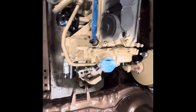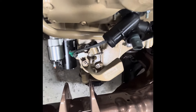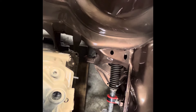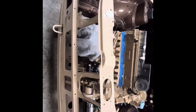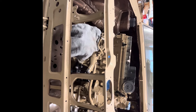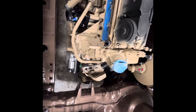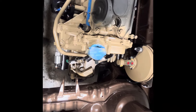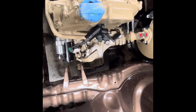We are really close to in position now. Our axle cup is now above our control arm mount. My poor little four-wheel cart has decided to split in the middle, so it's going to make it a little more difficult as my motor is sitting at an off angle. That thing should be sitting pretty level, so I'm probably going to have to get a little floor jack underneath my transmission and pick that end up a little bit. But we'll deal with that here in a minute. We are close to in position and we haven't — cross your fingers — scratched anything yet.